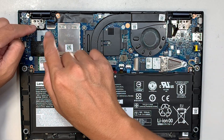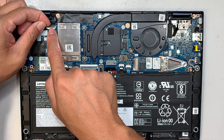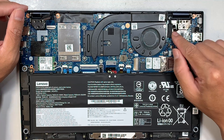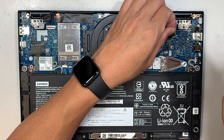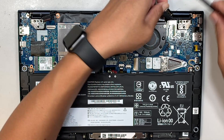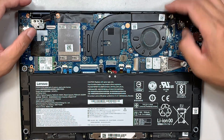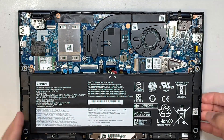The cable in the top left corner — you need to flip open the clip. There's a small black clip; flip it open and then gently slide the cable out of the connector. This is the LCD screen connector. For the other cable, you want to lift it straight up — they're kind of like Lego. Lift up while giving a little pressure at the bottom to pry open that connector. Once you have the two cables disconnected, go ahead and start opening up the screen.